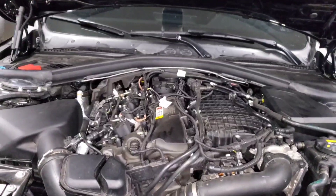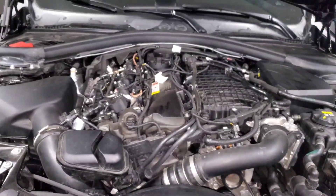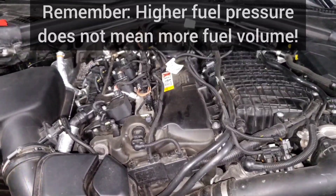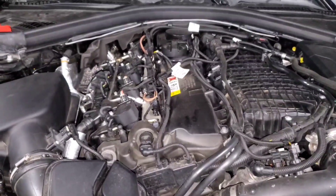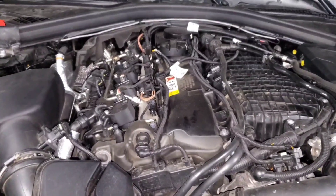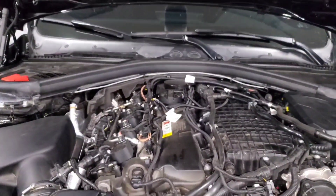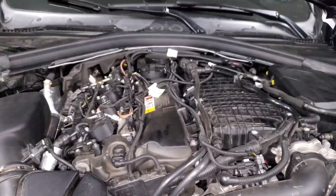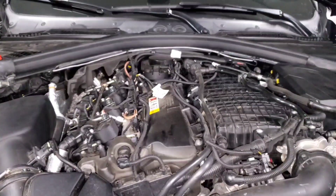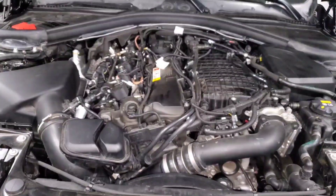So now to talk about upgrades. The first thing to get out of the way: the injectors are good for upwards of 600 to 700 horsepower. Some people have asked if the TU fuel injectors flow more because they're designed to run at a higher pressure, but that hasn't been proven and it's not very cost effective — they're like $400 an injector. The other thing is the low pressure fuel pump. We do have low pressure fuel pump upgrades available, but it's not needed unless you're going over 700 horsepower. Those parts of the fuel system are very robust and don't need to be touched for a while — unlike the older BMWs with the N54 and N55 engines where you had to upgrade the low pressure fuel pump.